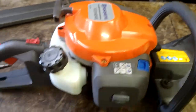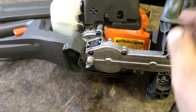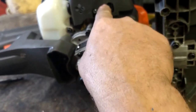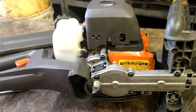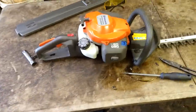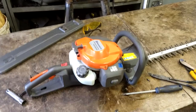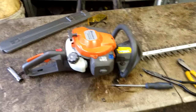Everything seems to be working. It needs a slight adjustment — the adjustment screws are down here. It's the H screw: turn it counterclockwise slightly and it should open right up as it's bogging a bit. I'll cover that in another video. If that helped you out in any way, give me a thumbs up and hit that subscribe button.